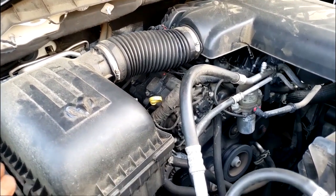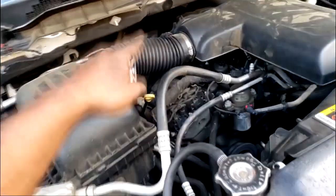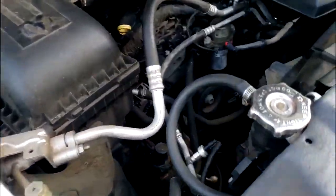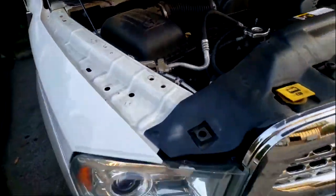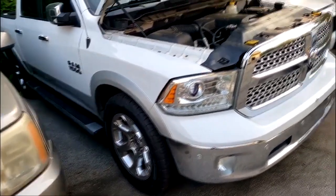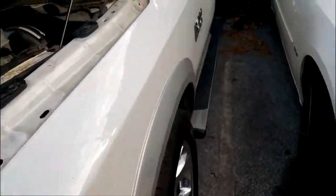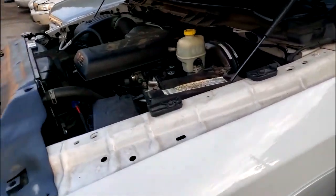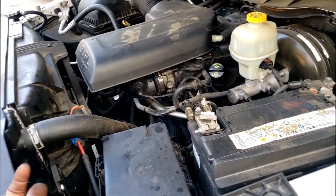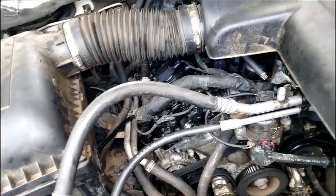It's dirty because we've been working on it, but I want it clean. Y'all see that rotary shifter? This truck is likely equipped with a ZF transmission. Look at that — 170,000 miles. I may have to tell my man it's time for a transmission service. Oil change required. Y'all see that light flash? Y'all know what that means — misfire. It's picking up a misfire as we speak — that's called active. I hear a ticking and I see a misfire.